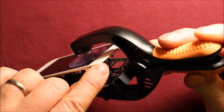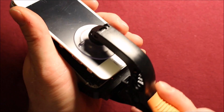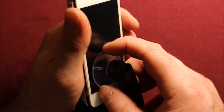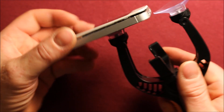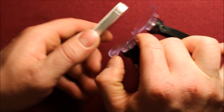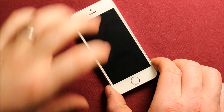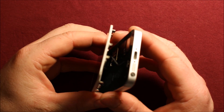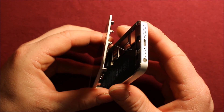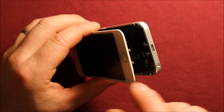If you can see that, there's a little notch right here in the screen — that's where you want to go. That came apart really easy, and then you can pull these tabs and just pop them off. Next we'll be opening up the screen, and be careful when you pry this open — you don't want to go too far because there's the ribbon cable here for the Touch ID sensor home button.